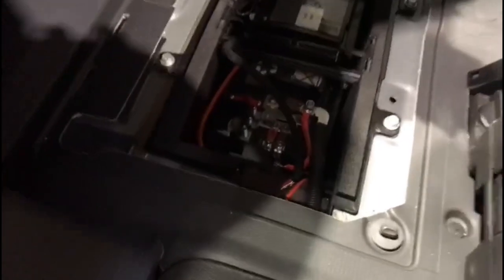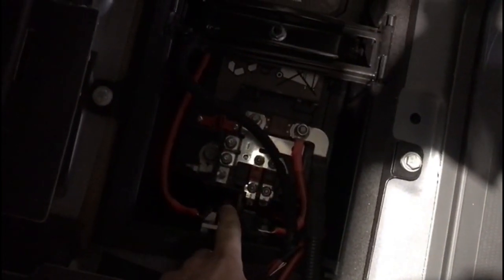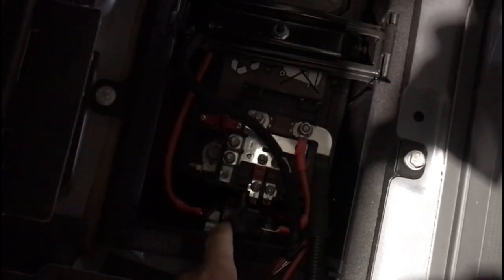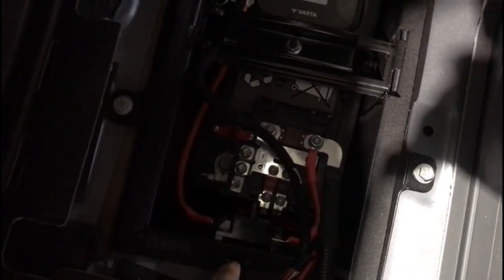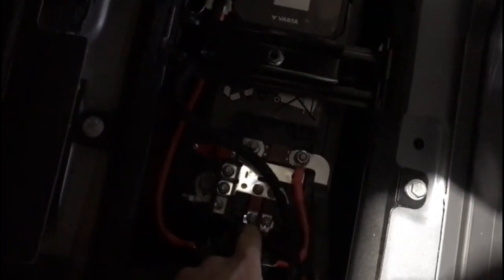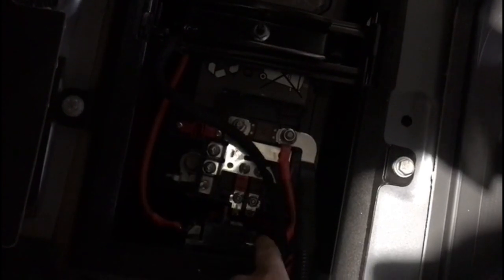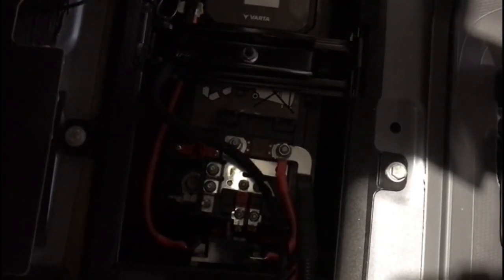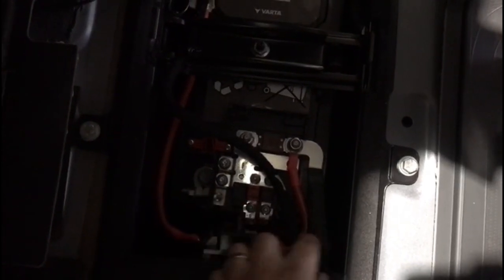Looking in the battery compartment, I've got the fuse breaker here for the DC-DC charger. You can see the 16mm positive flex running down through the bottom of the tray and into the 20mm conduit. The breaker is currently in the open position — open circuit — so voltage won't flow through the cable until I want it to. Once the DC-DC charger is connected, I'll close that lever to close the circuit and allow voltage to flow.